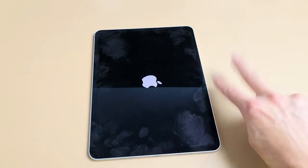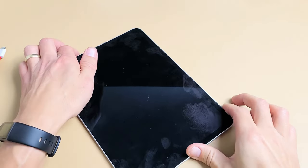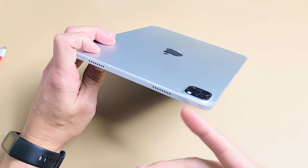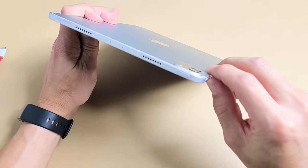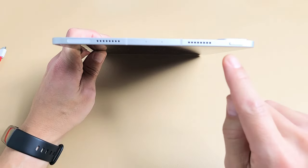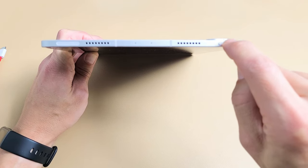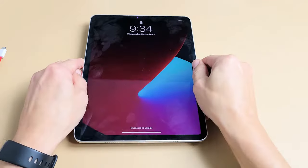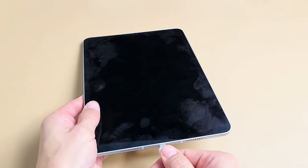If you're still stuck in a boot loop, we're going to go to step number two. It's possible that your power button is causing the boot loop — maybe it's stuck, jammed, or you got liquid in there. Also, if you have a case, take it off. The power button is here — just spam it, press it in and out multiple times. It could be stuck or jammed. Now grab your charging cable and plug it in to give it a bit of power.